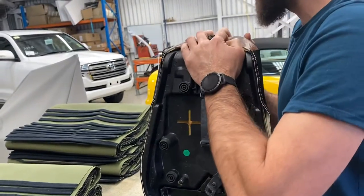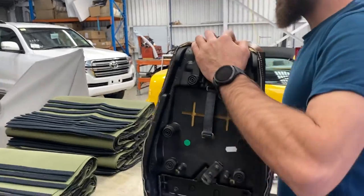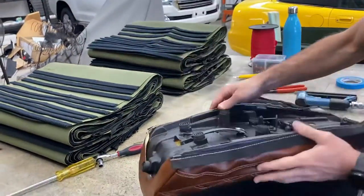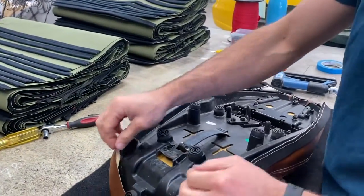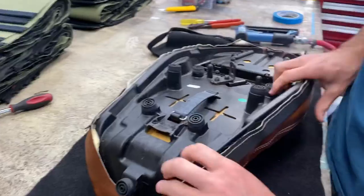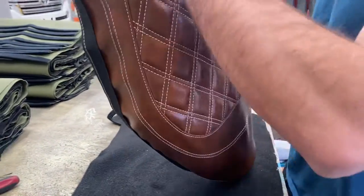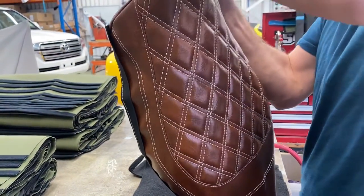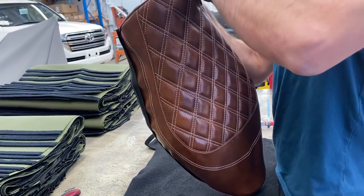But if you have the one with horizontal stitching, not really. It's not super crucial because you can always take that out if you find later that you need to shuffle things around a bit. Anything that you put in now is basically just to make it easier to hold it on there so that you can go around the seat and push and pull bits of vinyl so it sits where you want it to.